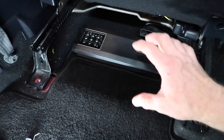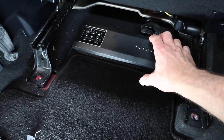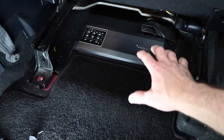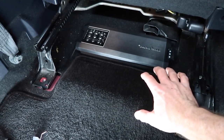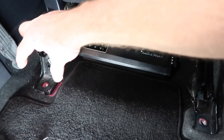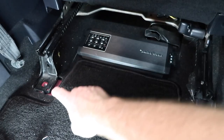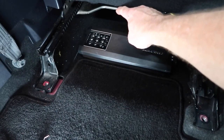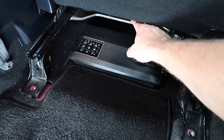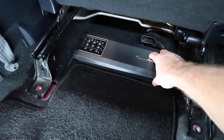Fernando and I have talked about it, and his plan, because this amplifier is a great amp because it's so small, but it's thin and long, and they have this that gets in the way, and this is just a weird place to put this underneath the seat in this particular car, but this is where he wants it. What we're thinking about doing is I'm gonna make an ABS piece that comes this way and across. It's gonna be kind of L-shaped, and it's gonna bolt underneath here, and then it's gonna come up into this area, and we're gonna have a riser that comes up to attach to this bar here because this bar doesn't move, and that way that'll be our two contact points to keep this amplifier nice and firm and secure.